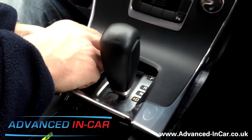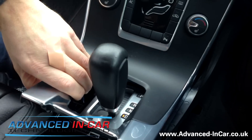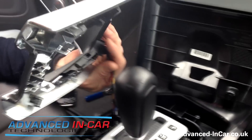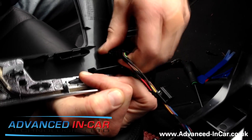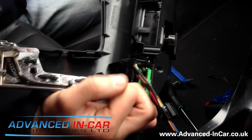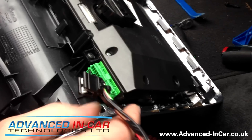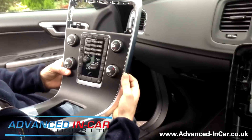Unplug the gear stick area, again being very careful you're not doing any damage to the surrounding trim. I'll show you as soon as I've unplugged this what's holding it on. What I've undone here is this clip which was attached to this bit here, and again you can just remove this one. And then of course you've got your typical green Volvo amp connector — that can just be depressed, push in first, push the button, remove like so. There you go — then you've got your Volvo panel.